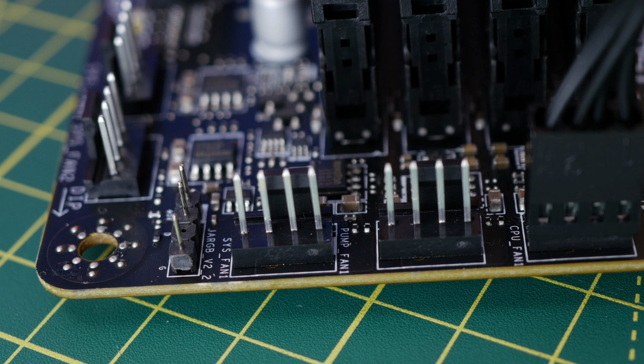And make sure you plug in the SATA power cable as well. And then you've got that powered, and then the RGB lighting for all fans is then covered. So you can see fairly straightforward setup. Now, I'm not even using all the ports on this, but if you had 10 fans, you could plug all 10 in there and then all of them are then lit up, as you can see from that connection. This is just for the RGB lighting though.